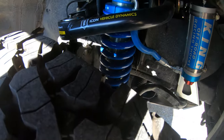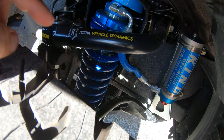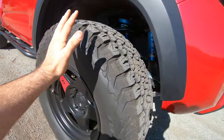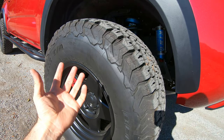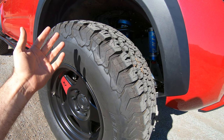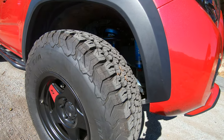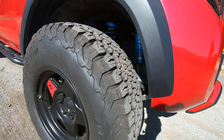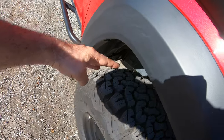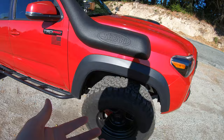Also, I went with the Icon Delta joint upper control arms. You need those in order to get the right alignment for these wheels to clear. This has about 4.25 degrees of caster. So basically that's pushing the wheel forward a bit and allowing it to clear, because the back, when it turns, would be rubbing on all kinds of stuff if you didn't do that. Which brings me to my next thing,